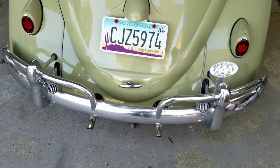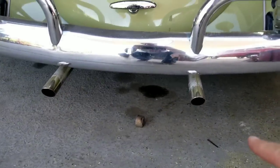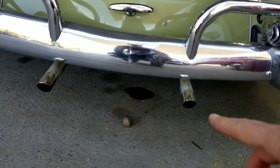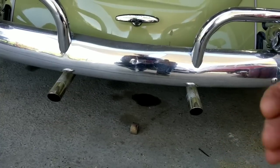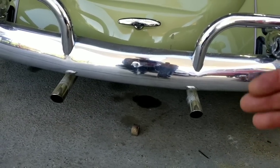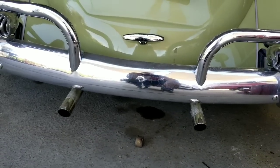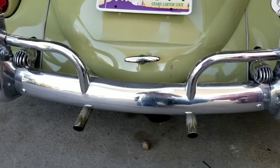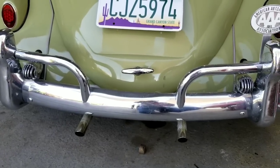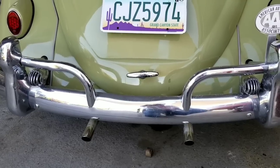On this car — which is a 36-horse — the pea shooters were actually straight-piped. The reason I did that is because it has too restricted a flow for the 36-horsepower engine, and we were able to go one more main jet up by doing the straight pipe. Let's do a cold start on it — pull the choke, it's a manual choke on this car.